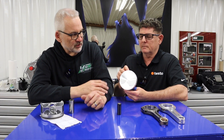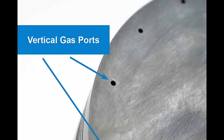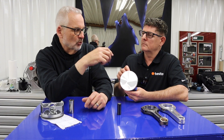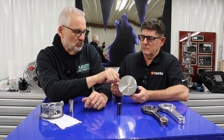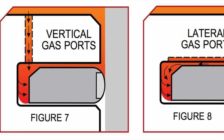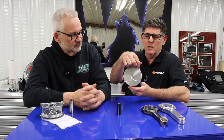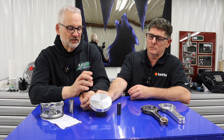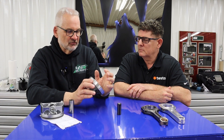Brian, you want to explain exactly what gas porting is? Yeah, gas porting very simply is the combustion pressure going behind the top ring and then pushing that out, putting more pressure on the combustion cycle against the back of the ring towards the bore. Not only are these very thin width-wise, but the radial thickness is also very thin to get very light tension, except when it needs it — i.e., the gas porting. And if you look up close in this piston, you can see there are holes drilled on the face of the piston. That's where the gas comes through and basically pushes that top ring out. It only does so on the power stroke or under compression, so the other three strokes the ring has less tension going up and down. The main intention is during combustion when you're getting those high cylinder pressures, you actually get enough pressure behind there to make a difference.